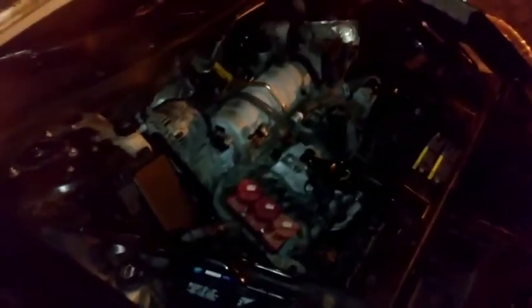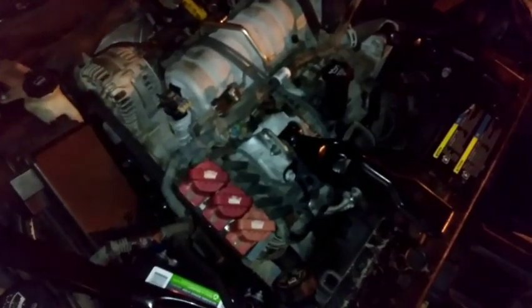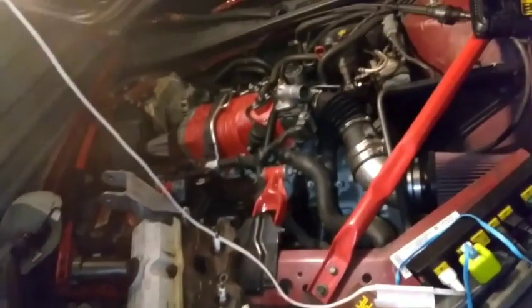And then tomorrow, once this is 100% done, running and driving and good to go, then I'm going to start tearing this engine apart. I need to get this blower and the heads and get all this stuff off of this engine. I need this rear head for the Red 07, because these are Series 2 supercharged heads that's on there, and they were a light port and polish, and these are just factory Series 3.